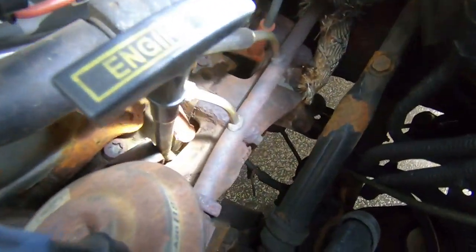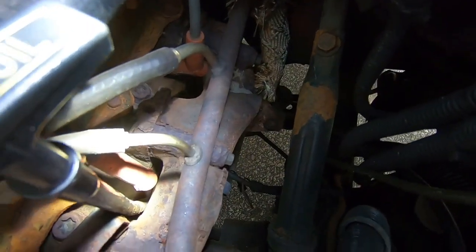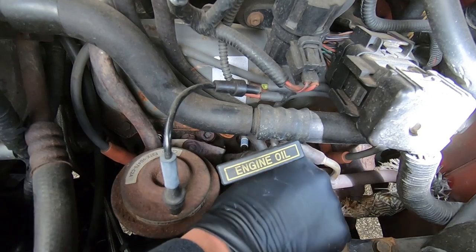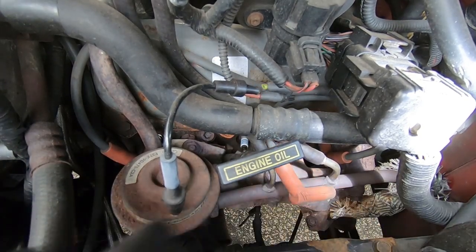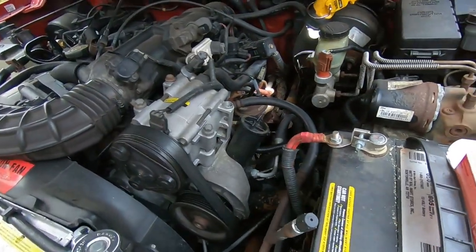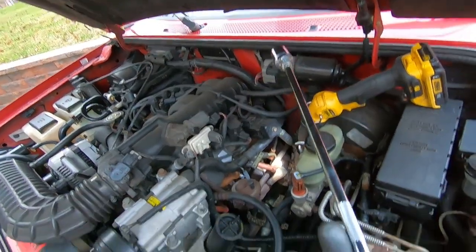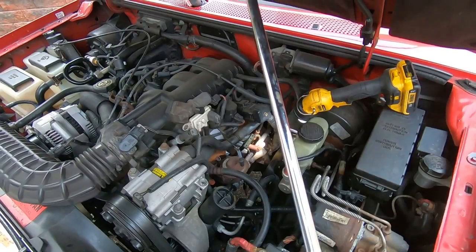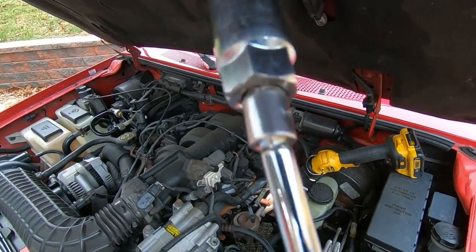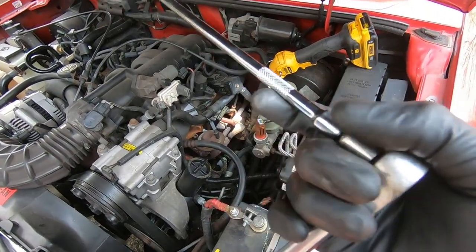This EGR pipe right here is going to be in our way for these next two plugs — not only the big middle one but those two little brackets as well. Just snuck my hand in, able to pull it out — there's the wire. Now let's go ahead and get that plug out. I have a specific combination set up here, and it's going to work. This is a 10 inch wobble extension with a 1/4 to 3/8 drive adapter and another 1/4 to 3/8 adapter the reverse way into my 3/8 drive ratchet.